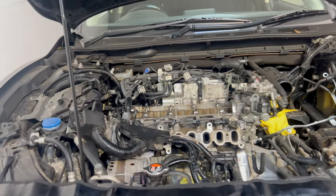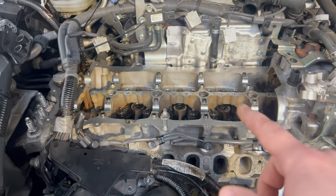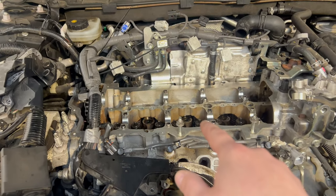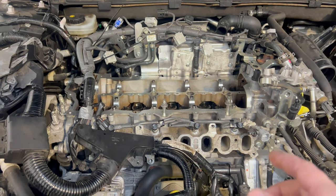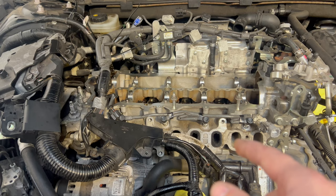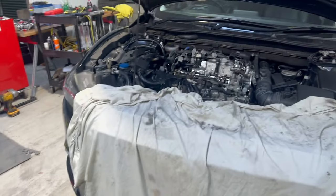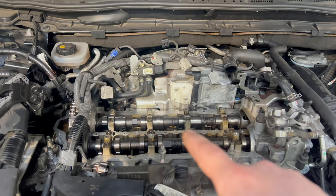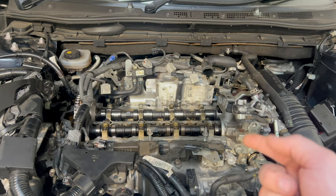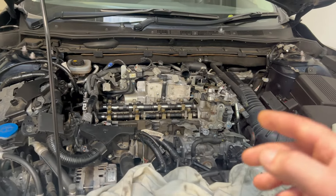Here it is - the two ports still need to be done. Here is the cylinder head cleaned - very, very good. I'm going to put back the tappets, journals, camshafts, and rocker arms, then replace the exhaust pressure sensor, do an engine flush, change the oil, and take it for a test drive. We'll check if the P0101 comes back or not. If not, we're good to go and can let the owner know to come pick it up. The second one is nearly halfway there - just needs the oil shower, valve cover, and a few other bits.